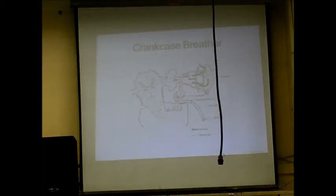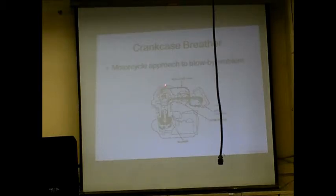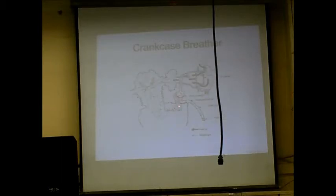Here's another view of it. On this one, instead of the blow-by gases coming off the top, they're coming from down below. This is a liquid separator — any oil that hits the separator will drip back down into the engine. If it gets past that, it collects in a little tube. If you've seen a tube coming off the air box with a plug in it, your owner's manual may say to remove that plug once a month or so to drain whatever has collected in there. A lot of times that tube is dry and doesn't have anything in it. The gases go through and get burned.